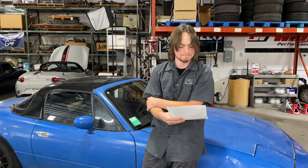Next: how to help with footwell tunnel heat. I actually forgot to mention this when talking about our insulation. I have the DEI insulation kit installed in my own car, and the biggest improvement I personally noticed wasn't necessarily decreased sound — there was a measurable decrease — but the biggest improvement was with transmission tunnel heat. The hot leg syndrome you often get with these Miatas because the exhaust is right there close to the transmission tunnel — putting this insulation in the chassis helped massively, taking it from obnoxiously hot to a bit more bearable.